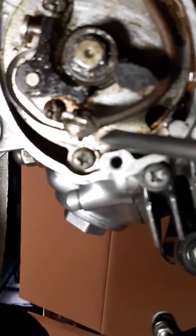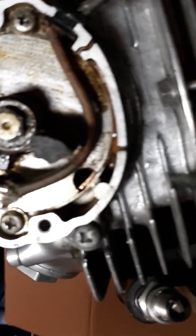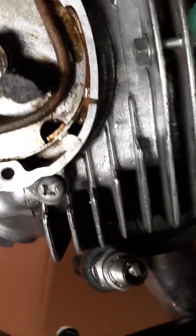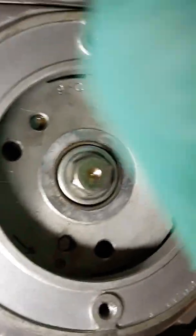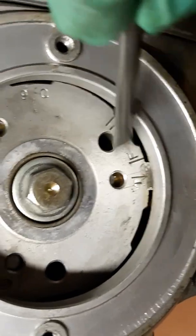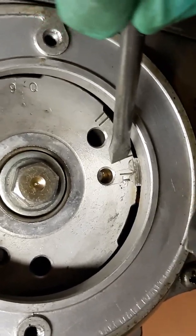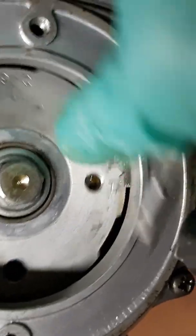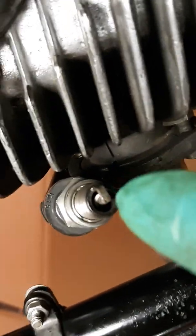After you disconnect this wire, you go between any ground and this wire that's now hanging loose. As you turn the flywheel, when it comes up to the firing mark, it'll start buzzing — then when it reaches the firing mark, it'll stop buzzing. Remember, you have to have this play or else you're at a false top dead center. What I wanted to show you — which I've never seen anybody do before to set the timing — is to use an active method with the spark plug out. Because this is more exact.